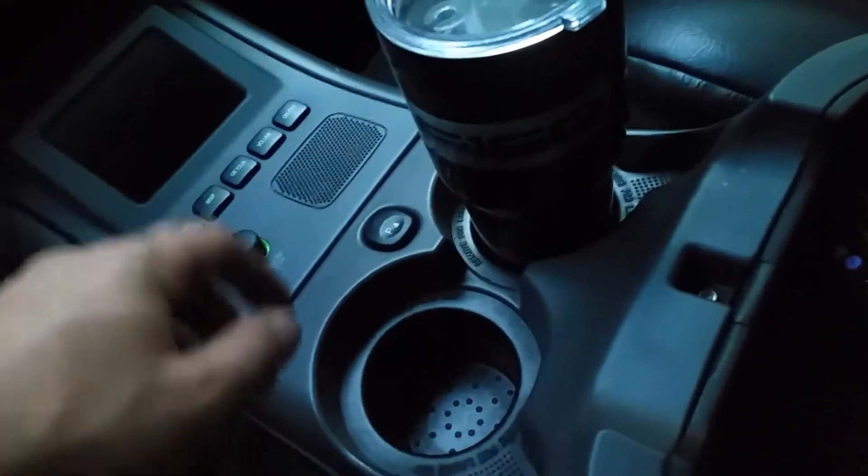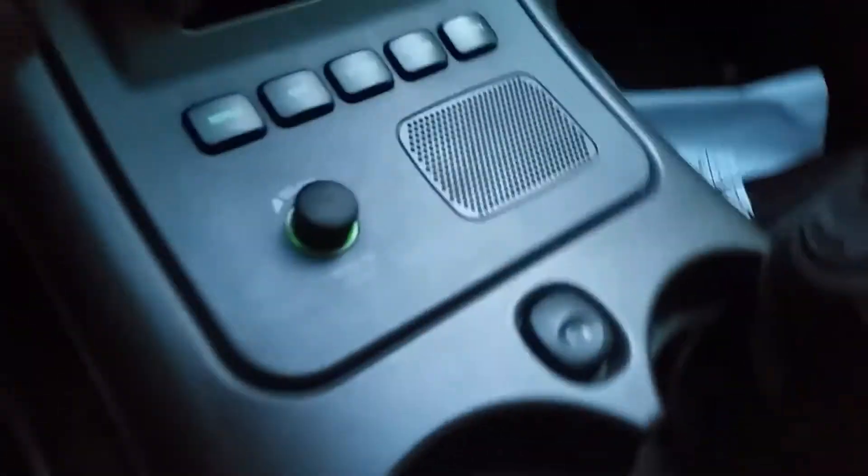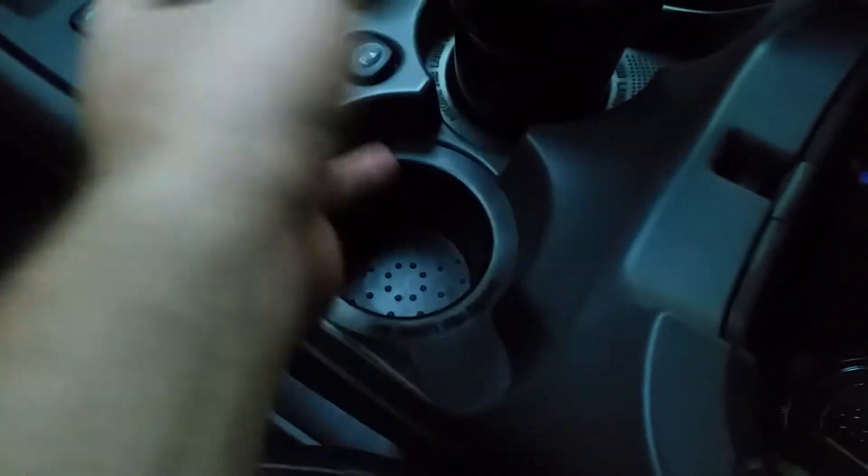I'm not really sure where to go from here. I thought maybe there may be a damaged harness where it's not sending signal to this. I think there may even be a hardware issue. The system does turn on and can identify that it's a bad disk or at least a disk not affiliated with the navigation. What I was able to find out with a multimeter and continuity tester is that the power and the ground are on the same wire for some odd reason.